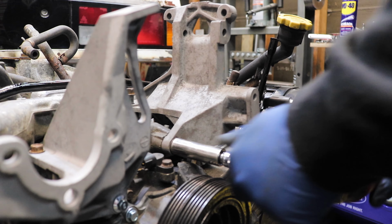Of the three different harnesses that I'm going to be making, one's going to be just the hot, you know, the power wire basically coming from the battery to the back, and then there's going to be a sub harness with the fuel pumps and the starter on it, the big actuations, and then there's the main engine harness, which is what we're working on right now, which is going to be fuel injectors and your cam sensor, your ignition, all the sensors and all the outputs, you know what I mean.